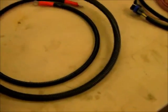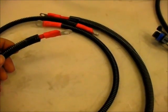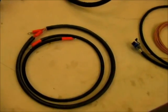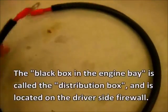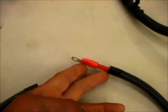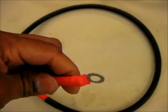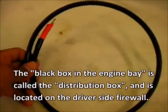There are two wires in the kit — heavy gauge red wires with black loom on them. One wire is a slightly heavier gauge than the other. These two wires go between the starter and the alternator, and between the starter and the post of the black box inside the engine bay. The larger gauge wire has two eyelets — the large eyelet gets connected to the post on the starter, and the smaller eyelet gets connected to the post on the alternator. The other wire also has two different size eyelets — the larger one connects to the post on the starter, and the smaller eyelet connects to the post inside the black box in the engine bay. This is the smaller gauge of those two wires.